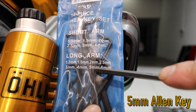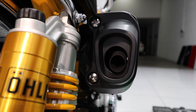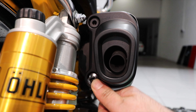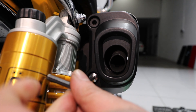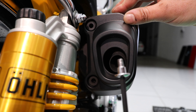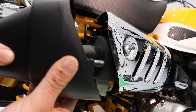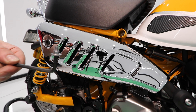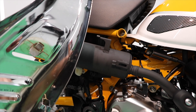So let's get to it by removing the original exhaust. Start by removing the heat shield — you'll need a 5mm hex Allen key to break and screw off the two Allen screws holding the plastic cap. All the screws, nuts and bolts on both the OEM and Yoshimura exhausts are in standard thread directions, so you'll be turning them counterclockwise to remove them. Then remove the Allen screw on the side holding the heat shield, slide the plate towards the rear of the bike and it'll snap out of its holding brackets and come off quite easily.